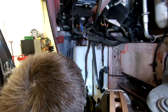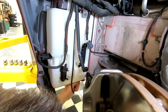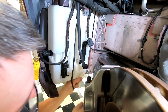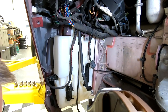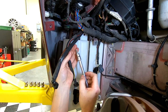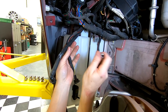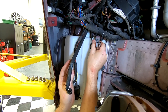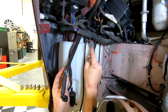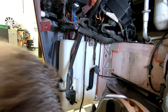So that's really my strategy here now, is I want to get all the bolts started. We'll get this easy guy at the bottom next. So that's just loosely started, and we'll get the one at the top here. Okay, so just a, because this has probably been bumped around, this is one of the fender liner clips. And it could get all cockeyed where it's covering up the actual hole it has to go through, so you might take a moment and realign that if it got bumped.